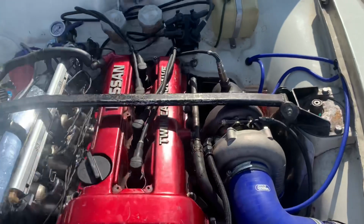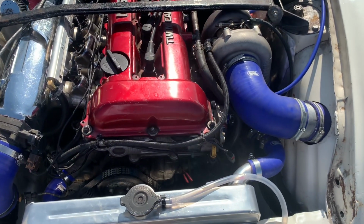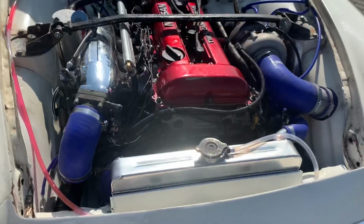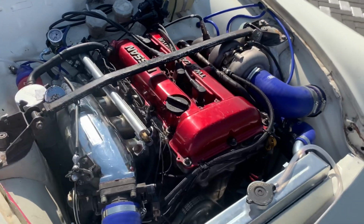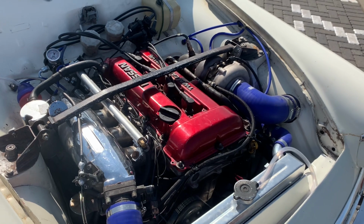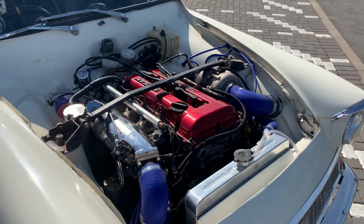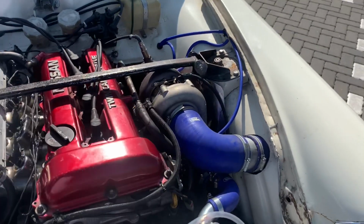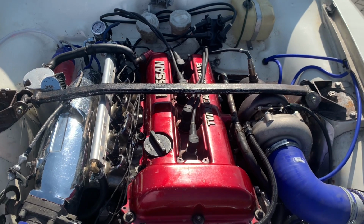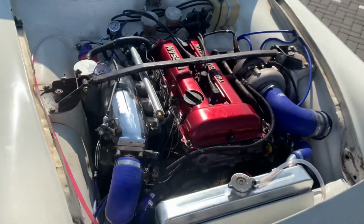All the goodies inside, like I say, I don't mind. I would actually love to do a detailed video if it interests people. I'll just kind of touch on the high stuff. So at the moment, we're running low boost, 1.3 bar, and we made just over 400 brake horsepower. I think we want a wee touch more than that, but I've got to say, very impressed with this new turbo. Before, this car was very laggy. Now, it's almost as if you're driving a non-turboed car.